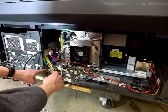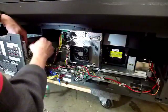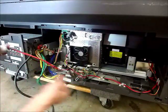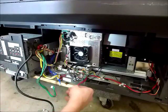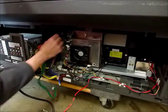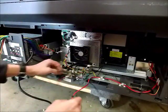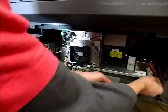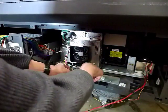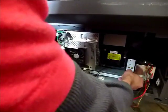On some models you'll have to remove two screws, one on each side of the chassis, that pull straight out. On certain models like this one, you'll have to unplug and disconnect the ballast power connector. Other models will have a connector midway that you can unplug so you don't have to pull the whole electrical chassis out. There's one connector to the engine power board. Fold these guys out of the way and remove them from all the little clips. There are two screws — one has the ground cables, one screw straight down. After that, the engine will just pull out.